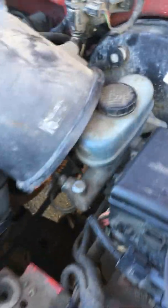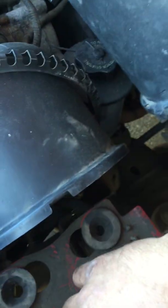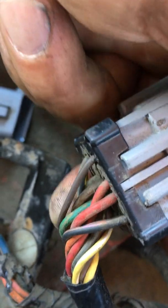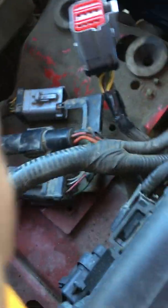The sensor is on top of the rear differential — the pumpkin. It's got one bolt that holds it on. It's got a red wire with pink stripe and a green wire with black stripe going to it. But in my case, I know that's not the problem because that wire comes up from the back and comes to this connector right here. On this side you can see a green wire with a black stripe, and the smaller one is the red wire with pink stripe. Get your handy-dandy multimeter.